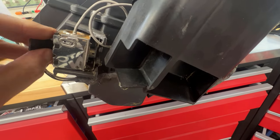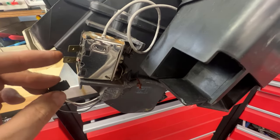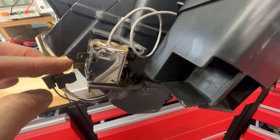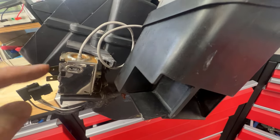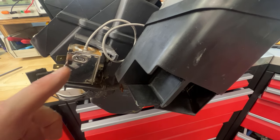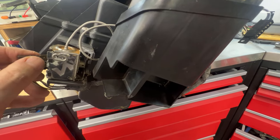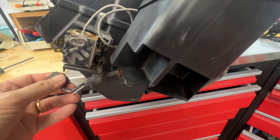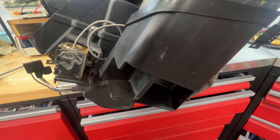Normally these two will be connected, meaning you'll have continuity between this one and this one, and if the evaporator starts freezing over then it opens the signal. So if your air conditioner is not working and everything else checks out, this thing might be preventing your compressor from going on, because the wires that come into and out of this freeze-over switch go directly to pin 30 of the air conditioner's relay. So if this is open you're not going to get power to the compressor.